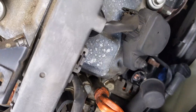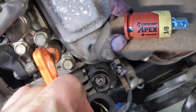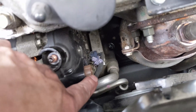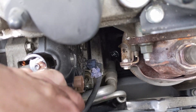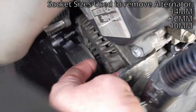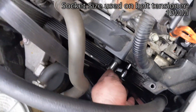I've already loosened this bracket and taken the ring terminal off the alternator. You want to make sure your battery is disconnected, or in my case I use an insulated adapter so my ratchet can't ground out the positive — just kept it tucked into the rubber boot. I had to disconnect the wire for the compressor at the bottom, remove the tie wrap clip off the back of the alternator shroud, and using a 14-millimeter socket I've removed one bolt from the alternator behind the bracket and am loosening the other. I've already used my belt tensioner tool to release tension and remove the serpentine belt.